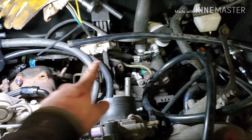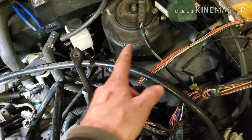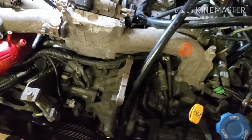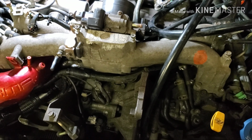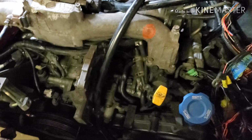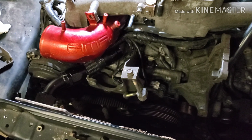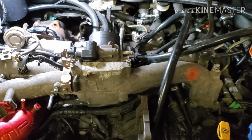Put the alternator on, put the belt on. I have to run the battery cables back over to here how it originally was, just because I never bought that one wire, the hot wire to extend to the fuse box, and for now we'll just keep it here. Gotta do that. Plug off any vacuum lines. I want to change the oil in this before I start it again, because this is like 3-year-old oil. And then obviously fill it up with some water and coolant. And finish up the AOS fittings. I think that's pretty much it. Put the intercooler on.